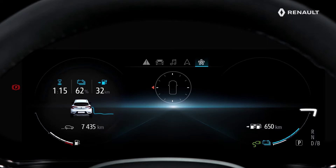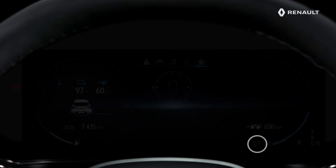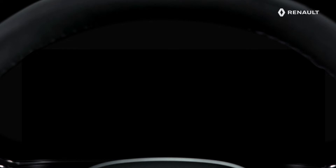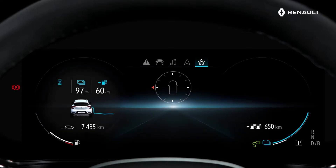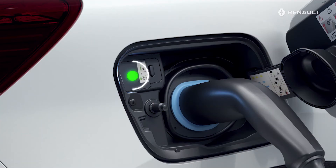At the same time, the instrument panel displays information concerning: the energy level on the battery indicator, the percentage battery charge, and an estimate of the remaining charging time. From approximately 95%, the charging time is no longer displayed. This light indicates that the vehicle is connected to a power supply; the display on the instrument panel goes off after a few seconds, and reappears when one of the doors is opened. When charging is finished, the indicator light in the flap lights up green.